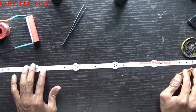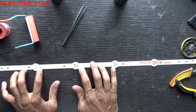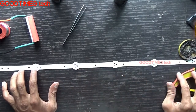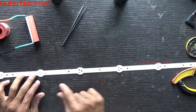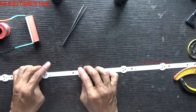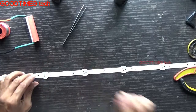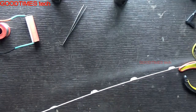Actually, testing shows this whole strip is working properly. The technician may have marked it incorrectly — perhaps he didn't check it properly. But still, I'll show you how to remove this LED and resolder it back. For that, just heat it a bit on the back side.